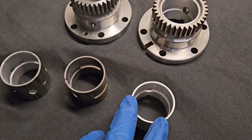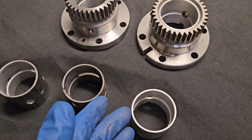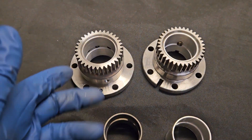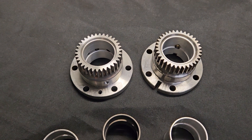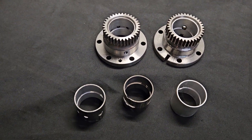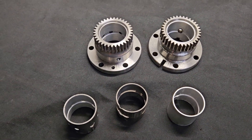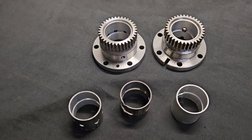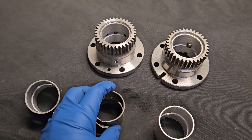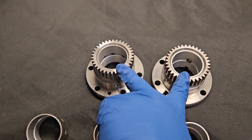It's not a dimension thing — although we do polish and modify our internal specs slightly, depending on the build. It really is more about oil volume and flow in a rotary motor to keep them alive, provided there is proper alignment to the motor and proper shaft-to-bearing tolerances. I hope this helps. I often get questions about rotary engine builds — what should I use, where does it apply? Here you have some great information about OEM multi-window, aftermarket three-window, OEM non-window, and a little bit of when to apply them.